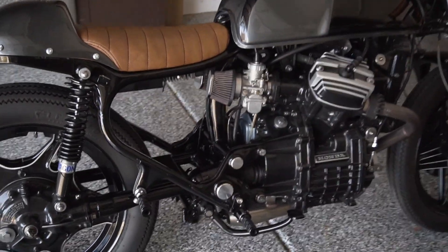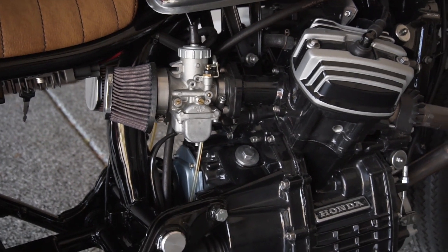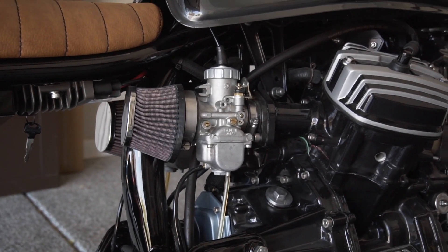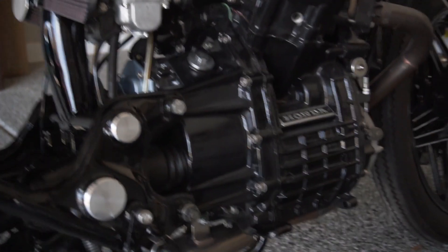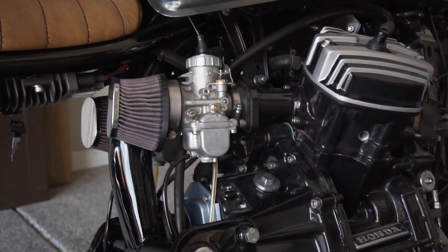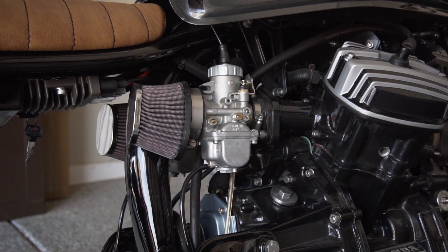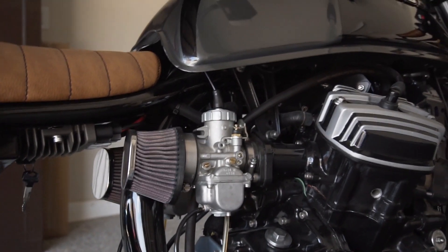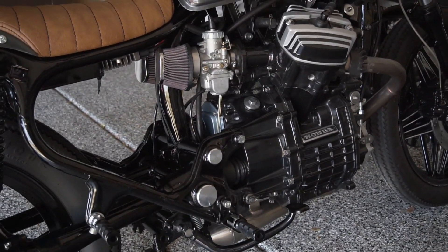Moving forward to the engine — I've got Murray's Mikuni CX500 carbs. They're Mikuni VM34s, I believe. A little bit pricey, but if you have a CX500, in my opinion it is hands down the best engine upgrade you can do to this bike. It really wakes it up. I struggled for weeks trying to tune this motorcycle with the stock carbs — I tried every jet combination possible and nothing was perfect. As soon as I slapped these Mikunis on, it was a thousand times better. I would recommend these to anybody that owns a CX500. I think he's making these kits for other older Hondas now as well.